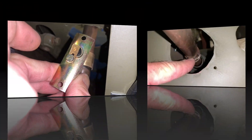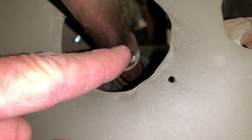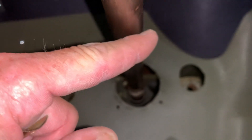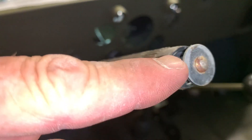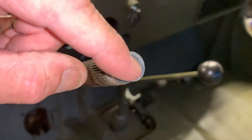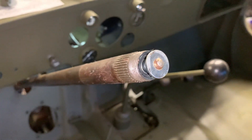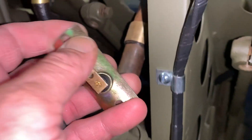I've taken some 220-grit sandpaper and cleaned up that ring so I can get a good positive contact. There is a wire soldered onto the outside of the ring that travels up through the inside of the steering worm gear to the top, where you've got your button and spring installed. When you push that button it grounds the complete circuit, and that is what enables your horn to sound. We'll get into that more when we install the horn.